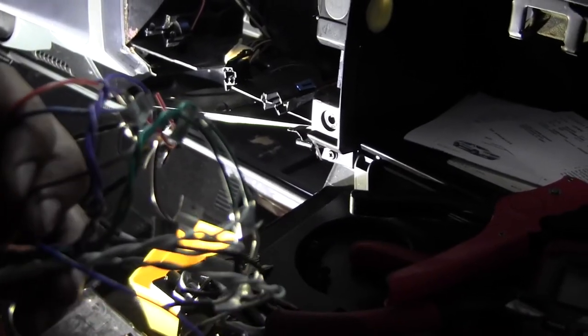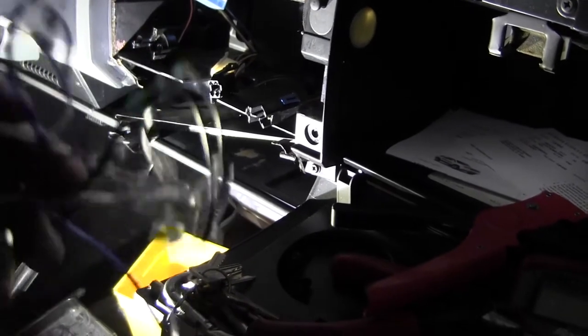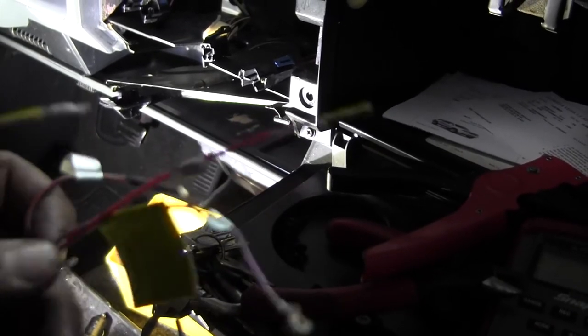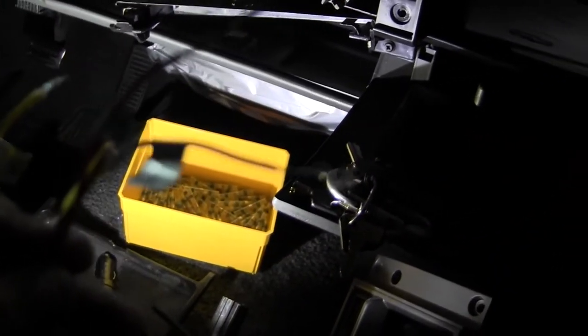As you can see, some of my wires are twisted up. Those are my speaker wires. I twist them up because it helps reduce interference. Whenever you have your radio wires going near power wires, you always have a chance of radio interference. This has one extra wire that not a lot of radios have, the pink wire.